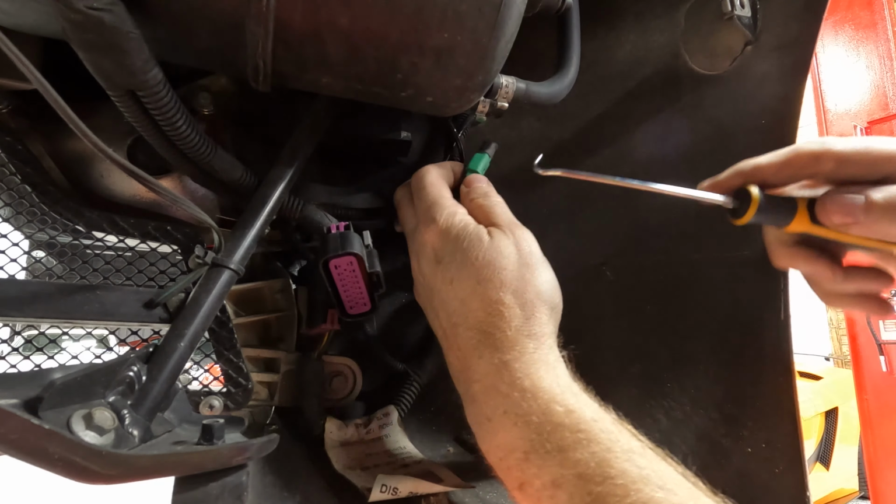Okay, secondary air is connected. O2 sensor is connected. That took a long time. Let me tell you, the hardest part about this, honestly, is the secondary air, because it's a total bitch. Look at all the tools you're having to use to do this. I've used every single one of these tools. It's insane. And the other trick is get some high temp gasket maker and glue the little stupid secondary air gasket onto the pipe before you stick it up there, because as soon as you start trying to line everything up, it just falls off and it's absolutely impossible.